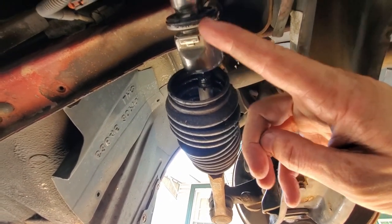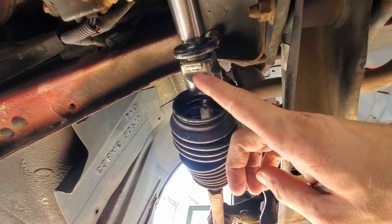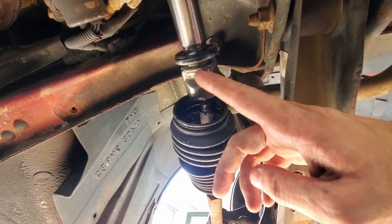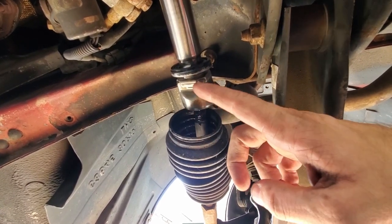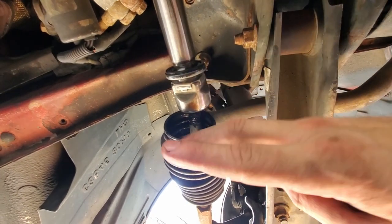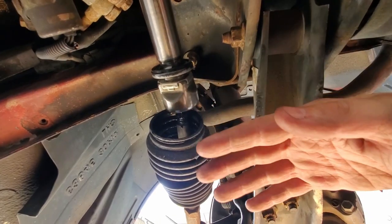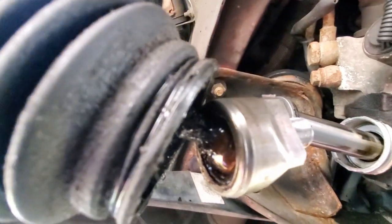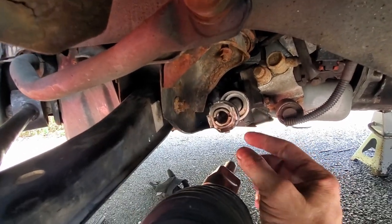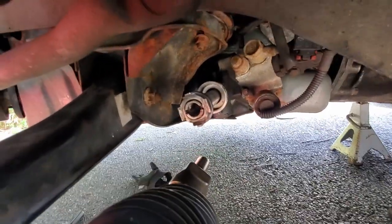Now being on the inner part of the car — this is your inner tie rod where it hooks up to the actual power steering rack. It has this metal retainer clip. There are two ways you can go about this: you can destroy it and you'll have to buy two more replacements, or — and I've learned this — if you take a flathead and pry up each corner carefully, there are four sides, and if you keep them kind of straight you'll actually be able to pry them back down once you tighten in the new inner tie rod. Once you break it loose you can use your hand. I'll just pull it out and let it drop closer to the ground. If you're going to reuse the metal clip, just leave it on there; if not, pull it off and add the new one. You'll see the two edges where you'd use a screwdriver and hammer to lock it down, but I'm going to reuse it.